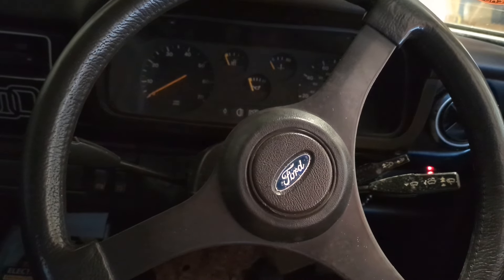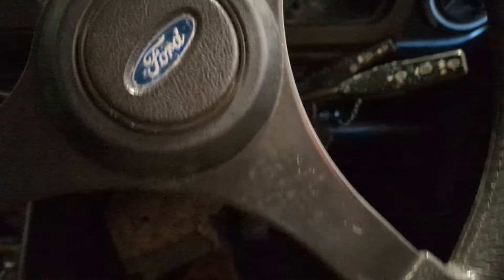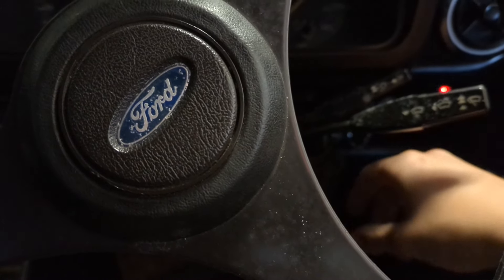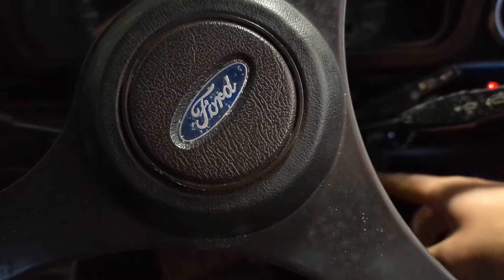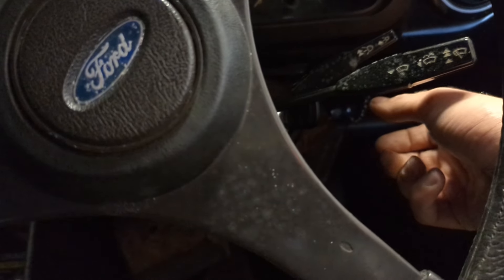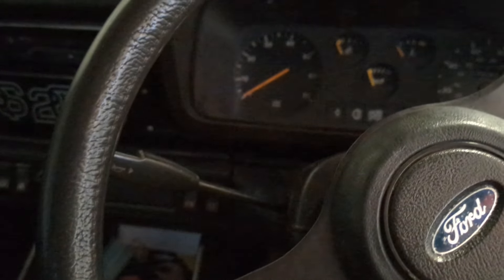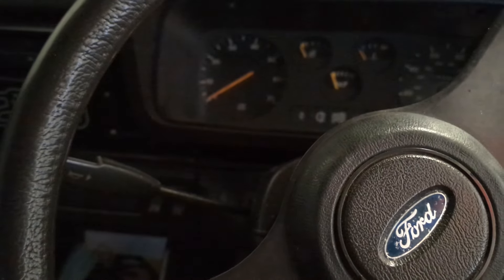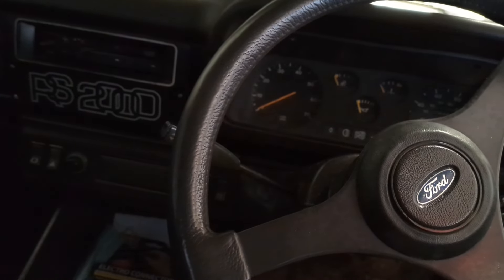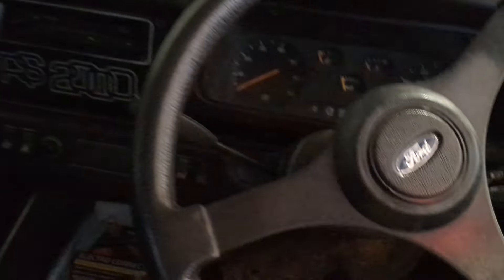That pre-engage starter — it's got the usual Ford quirk. It's quite annoying because on other cars you can turn the key and release it and turn it again and the starter engages. Well, with this one you've got to turn it back a notch before putting it on the starter again, which is quite annoying. Anyway, I'll give it another go. Of all the cars, this is the one that is the hardest to start after it's been stood a while — it does not like standing around, this car.